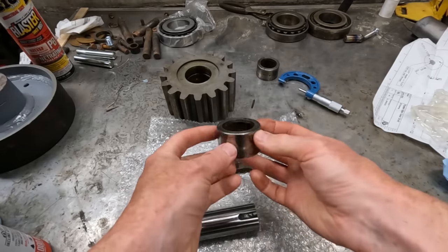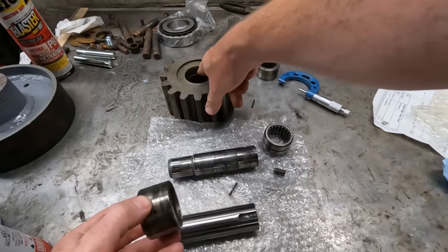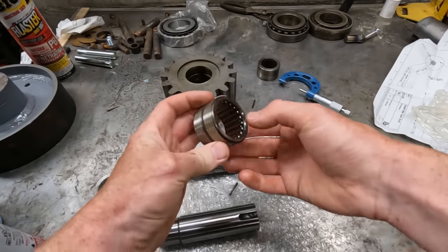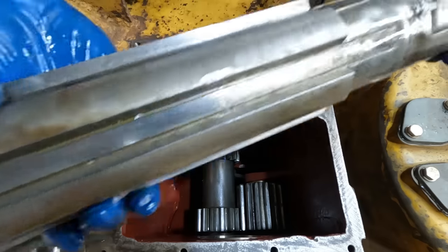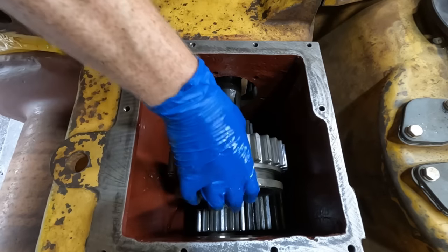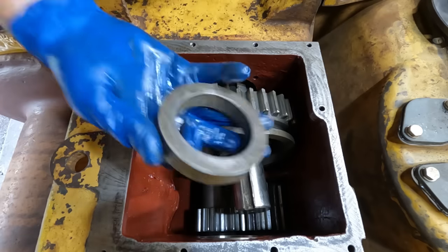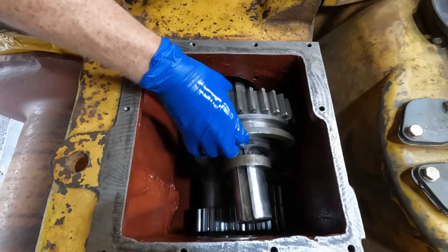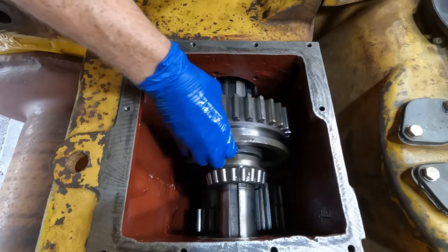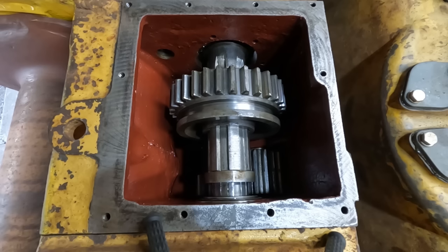The original bearing is a free-floating needle bearing design — in fact the needles are falling out and breaking, and there's no oiling groove in it, though there is one in the gear itself. The new one has the same trade number — I think it's just an updated design with an oiling groove cut in and it's a caged needle bearing, so they can't move, and the bearings are actually quite a bit bigger. I've got the shaft ready to go with the bearing installed on this side. Try not to damage the seal on the other end of the shaft.